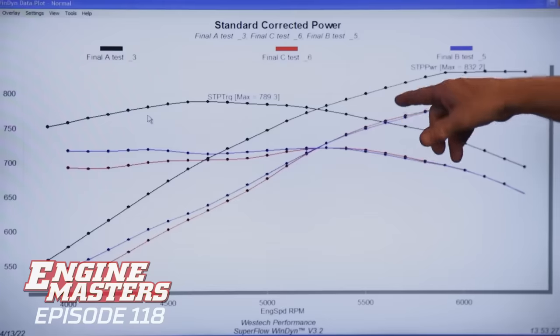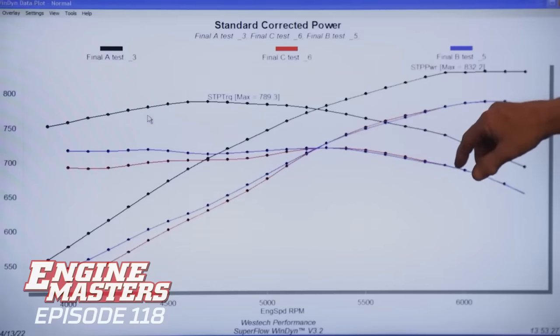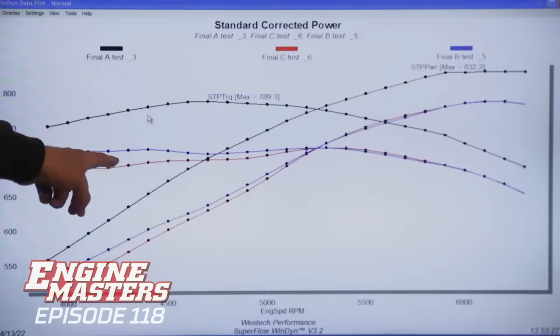Yeah, and in an odd way, kind of intuitively you think, well, there's less exhaust, so exhaust isn't going to be as critical. But that's where it made the biggest difference. Up top, it was really kind of nothing. Well, my theory on that is that when you put that Y in the pipe, you're getting some exhaust going out to the side, and at low engine speed, there isn't enough exhaust pressure to overcome whatever turbulence it creates there. At high RPM, you've got it just blasting through there and it doesn't care anymore.